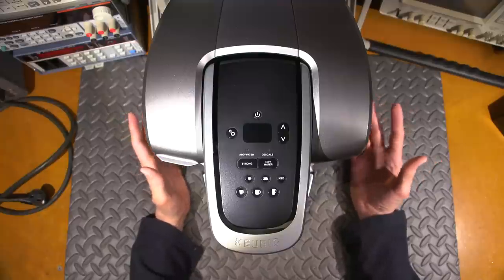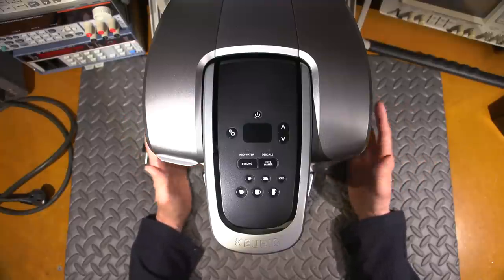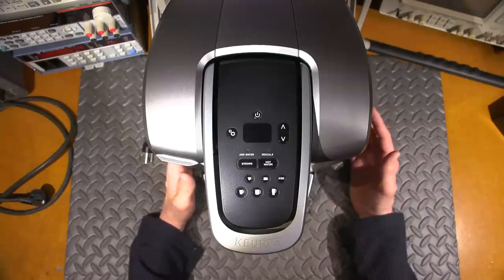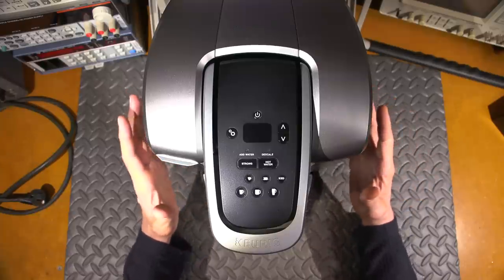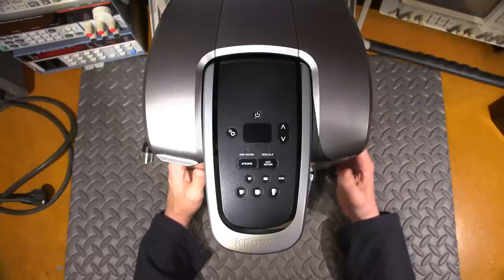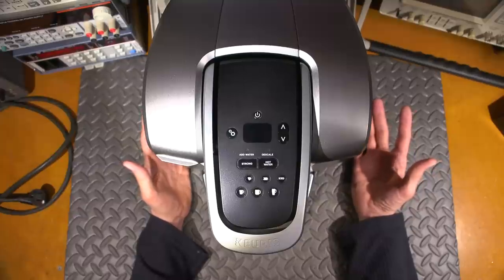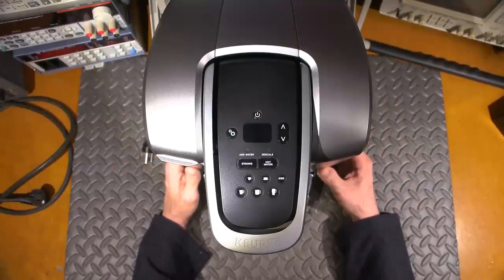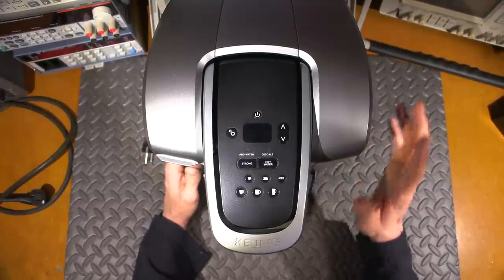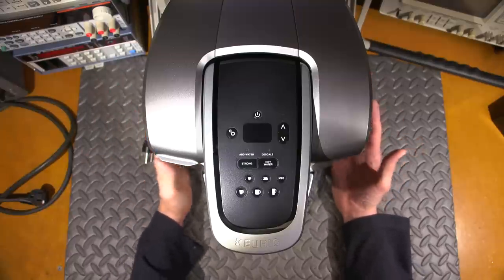This one here was a little bit odd since the day I got it. You might be asking yourself - either it makes a cup of coffee or it doesn't, right? Well, this thing is an RF fire hose. When I say an RF fire hose, I mean this thing makes a lot of noise on the shortwave, amateur radio bands, and AM broadcast band, to the point where strong signals are even affected. Weak signals are completely gone, even using an external antenna far away from this.